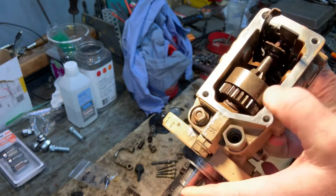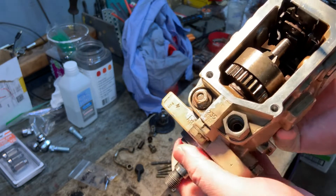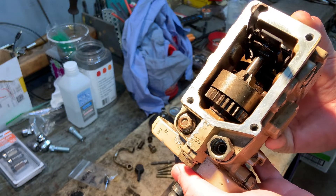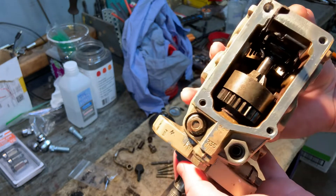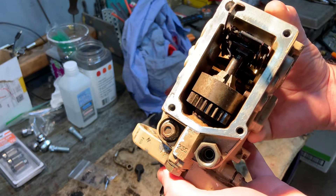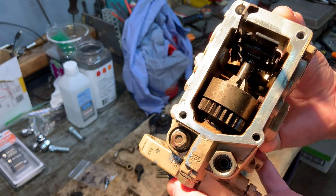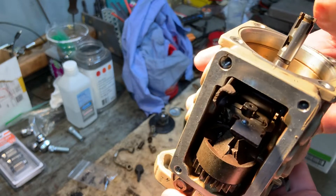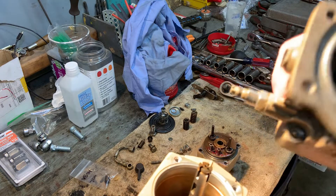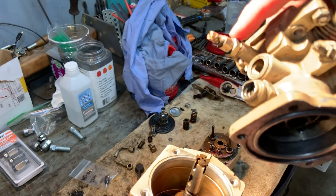What happened was there was some moisture in the fuel. The moisture congregated on the top side of this cover — your governor spring housing cover. When I went to start it, luckily I had a steel plate handy, just a piece of 2x4 or something in case something went wrong. So when I did start it, it went max RPM instantly. I had to use the metal plate to cover the intake hole going into the head to kill it.